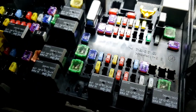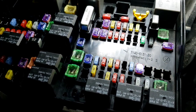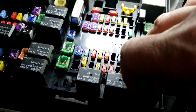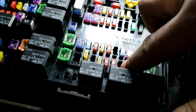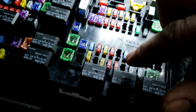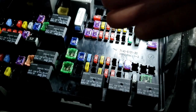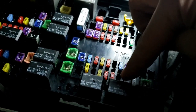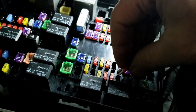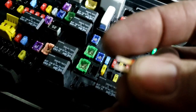For those of you who don't have the remote wire, or the amp isn't turning on, you're going to need to hook it up to pin 96 right here. You want the wire side — if you're looking from the front, you want to look at the back side, which is this side right here, not the front. So you want to wire it up on this side.